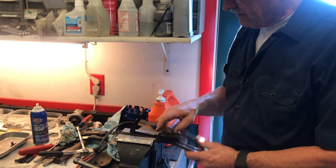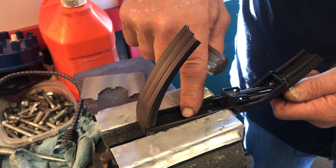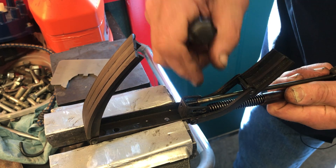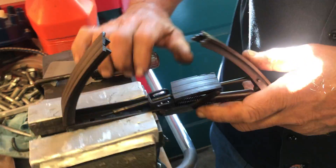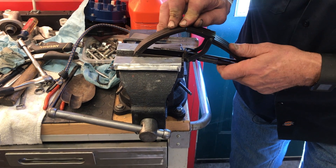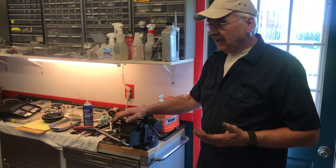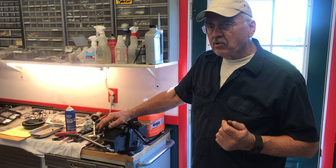What you need to do then, removing these parts for clarity, is pull up on the part of the tensioner which rests in a guide or track inside the engine. You pull up on that to the point where you can then release the latch, and this pin slides up through the latching mechanism. The tensioner then imparts a significant curve to it, which takes the tension out of the chain. It's a fairly simple device, but as you can see from the two broken ones I have, if they're old and brittle there's a really high probability they're going to break as you stretch them.